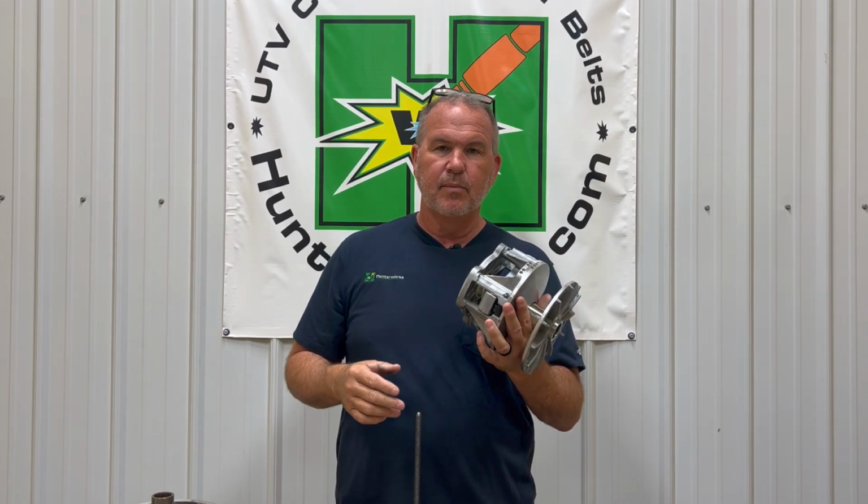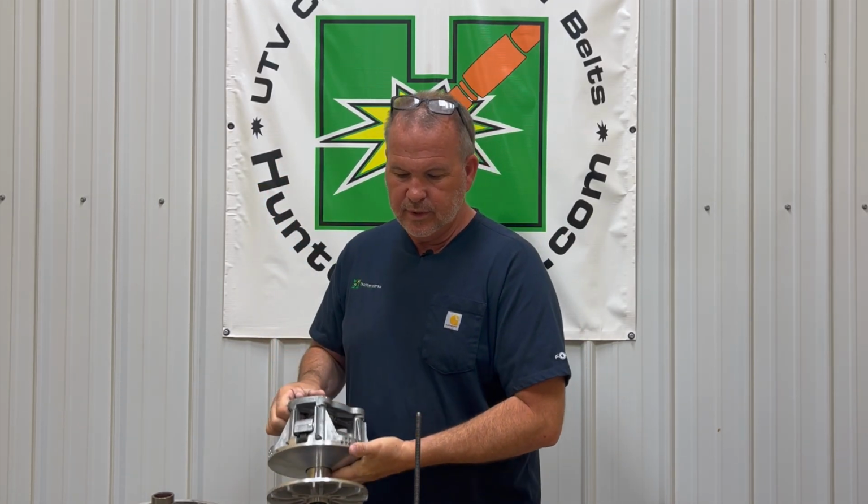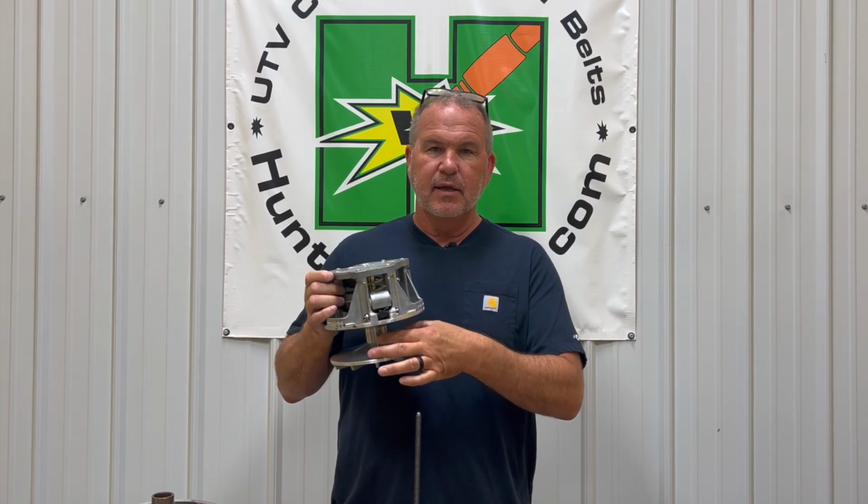What do you get? You get a Hunterworks USA made primary clutch. We have videos explaining what our Gen 3 Hunterworks primary 900 clutch is. It will be stock. What is stock? We have weights made. We do not use Polaris weights. These are machine weights with a better bushing, and then a primary spring that's equal to stock. So it will function as stock. It will only have a two-way bearing. We do not do EBS, full-on engine braking.